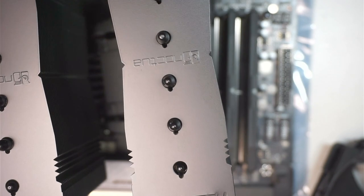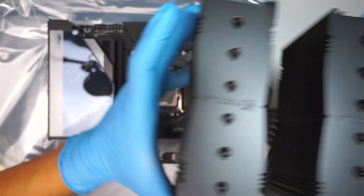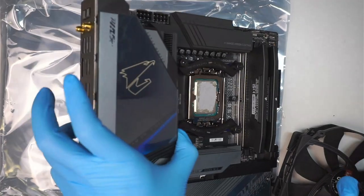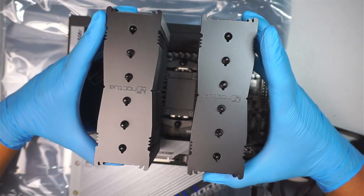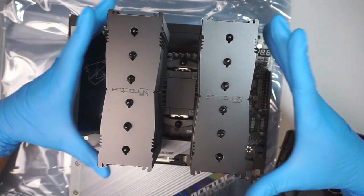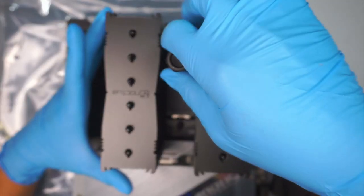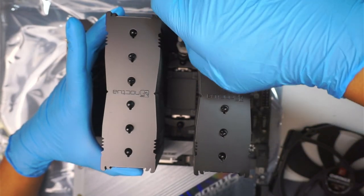Let me zoom out a little bit. Okay, you have to face. So the motherboard, the USB is on this side of it. You're going to face that and sit on top like so. So you're sitting tight, squishing the thermal paste. Right now it feels like the thermal paste is holding that heat sink. Get a Phillips screwdriver, you might need a longer one, and go ahead and fasten that screw.